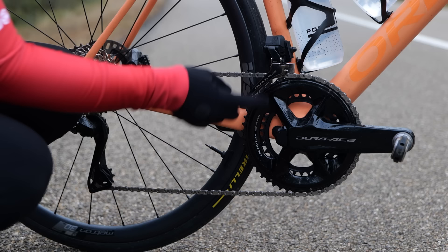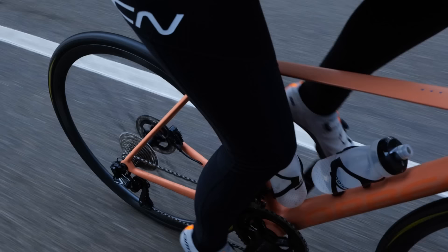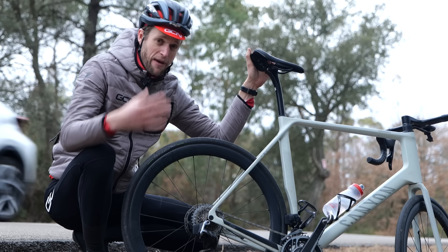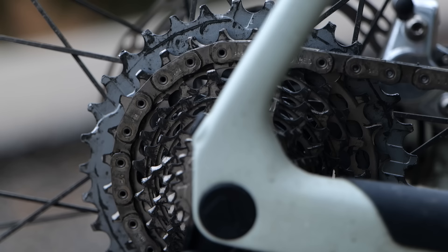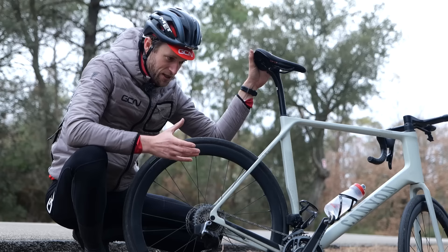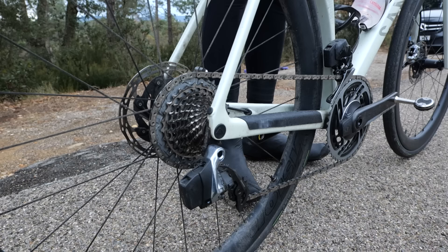This is your front mech, and it will essentially change the gear from your big ring to your little ring. On the rear cassette, it's actually the smaller cog which is the harder one. When you're traveling fast, you need a bigger gear to match the speed you're riding at — that's when you're looking for those smaller cogs. The bigger cog is easier for when you're traveling up climbs. You may hear cassettes described by their speed: eight-speed, nine-speed, ten-speed, all the way up to 12-speed, and there's even a 13-speed option now. That is the amount of cogs on that rear cassette.